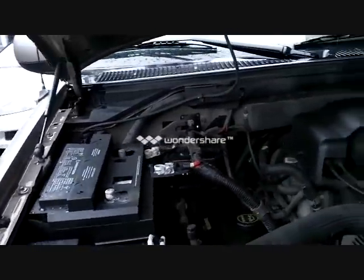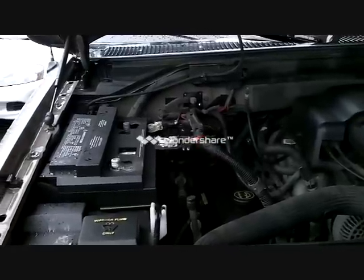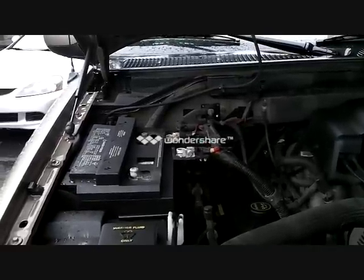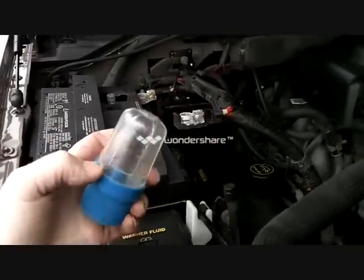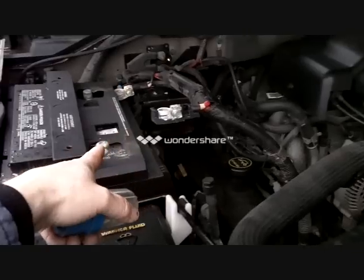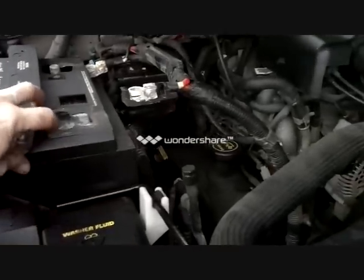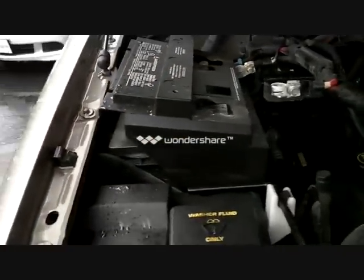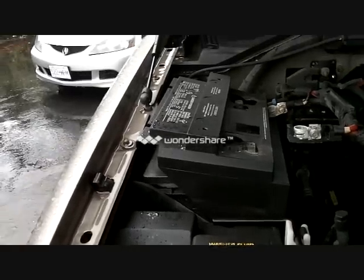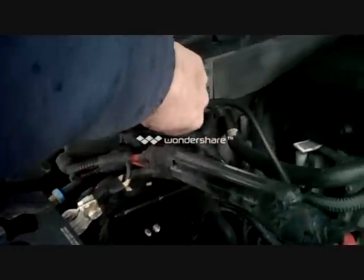I shut off all the electrical parts I had going — like the lights, radio, and heater — before I disconnected. Remember I wanted to discharge all the capacitors. Now I'm going to use one of these handy little units to clean up the posts and put a little bit of dielectric grease or electrical compound on there, and check the electrolytes in the cells themselves. If there's any acid that's spilled over you can use a little bit of water and baking soda to neutralize it — it keeps the body from rotting. Hook it all back up and we'll give it a test and see if it works.